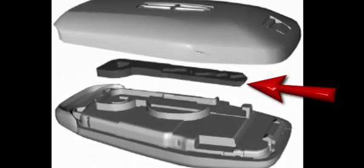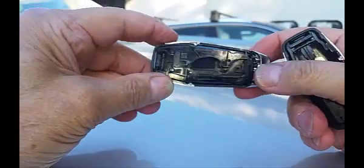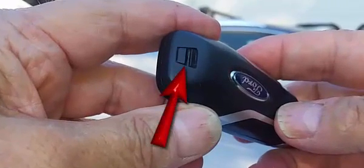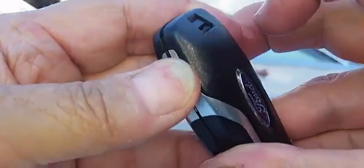And it is hiding. This Ford key remains as awkward to use as any we've come across. The key is between the two halves of the fob, which need to be opened up, as shown. You will need to get a fingernail into a tiny slot in the slide lever, as shown. Slide it down while using the same fingernail to pull the cover away.